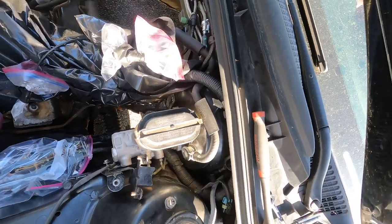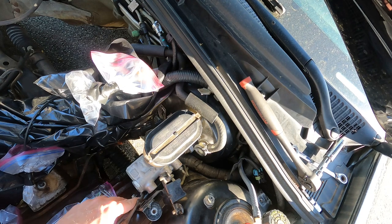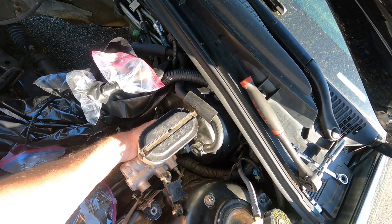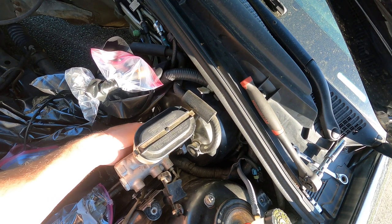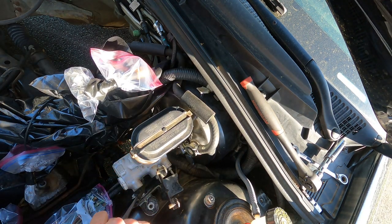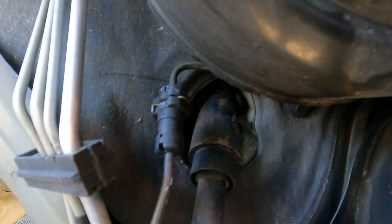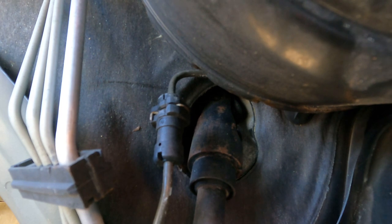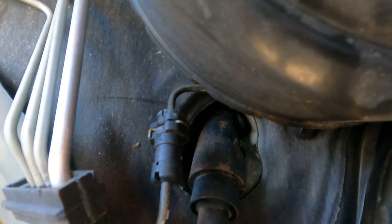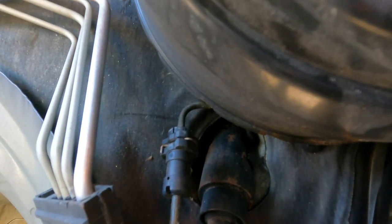I'm going to show you this best I can. You're not going to get a whole lot of movement on the brake booster because you have brake lines, but just enough to get in there. Give this a little tug and we're moving out a little bit - not a whole lot, but just enough. Down here in the engine bay, there's another clip you got to take out too. Same thing - pair of needle nose - pop that little clip and you can disconnect the line from the master cylinder and drop it out of the way. You need to disconnect that because it goes down to the transmission.